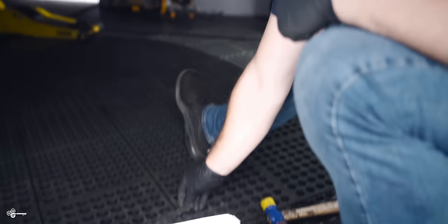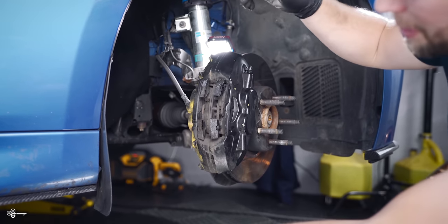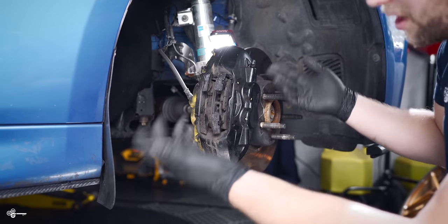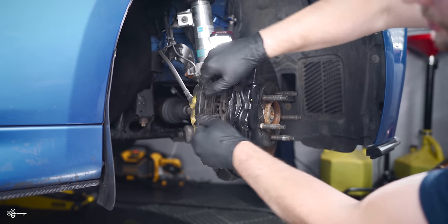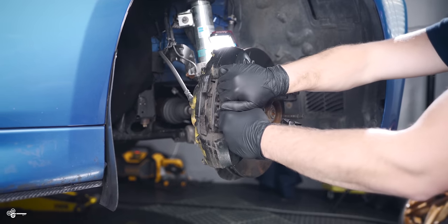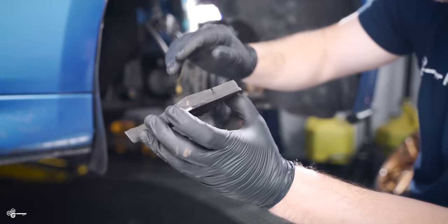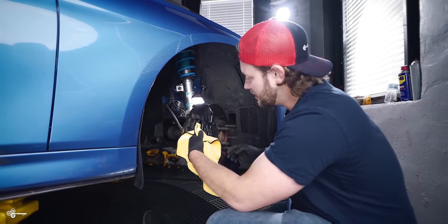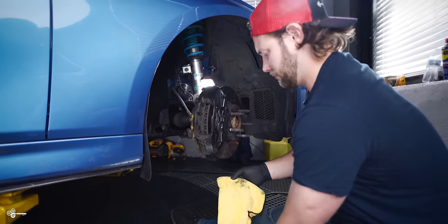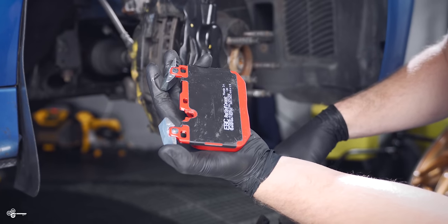So if it goes like this, I'll typically take it out and put it on the ground like so. With this style Brembo, it literally has it so you can just drop the brake pads in from the top. My favorite feature about this is because of how it's designed — you can just press into the piston just like that and it's going to compress it, so you don't even need anything to compress the pistons. Look at all that grossness that was trying to get on my wheels. So once you've done that, I typically like to get in here and give it a little clean.